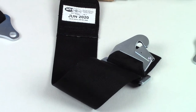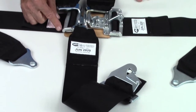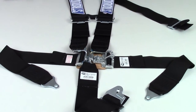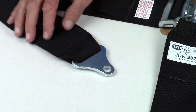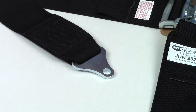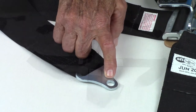Keep in mind the crotch strap is a critical component of the seat belt assembly. It must always be used to keep the lap belts in the proper position and to prevent you from sliding under the harness or submarining at impact. These lap belts are permanently sewn with a bolt-in tab, but they can be ordered with a three bar adapter. It bolts to a tab welded to the roll cage for an extremely secure attachment.